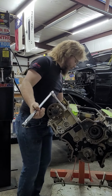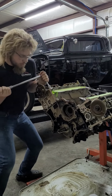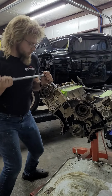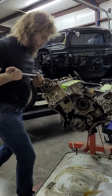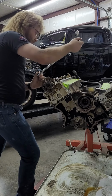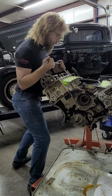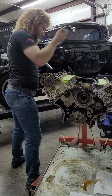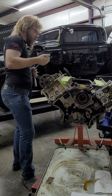And this motor really does not want to stay put. It's still tighter than it should be. Starting to wonder if the 2 valves have a tighter torque spec, because I know the 4 valve wasn't this tight. It's close, but not quite.